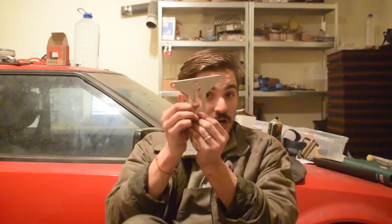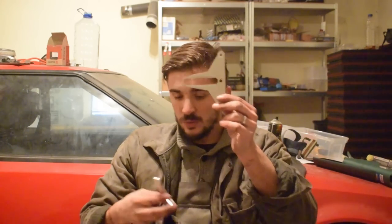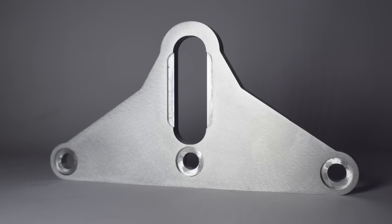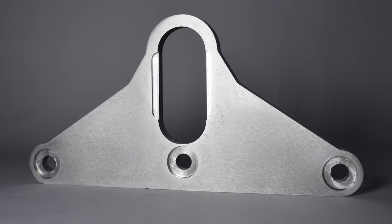It looks really simple but it's really versatile. This time I made it available in several versions: a long one if you want to run a Ford-type crankshaft sensor on a dual roll crankshaft pulley, a short one for a Ford-type sensor on a single roll pulley setup, a long one suitable for GT101 Honeywell-type sensors on a dual roll pulley, and a single roll pulley version for GT101-type sensors.